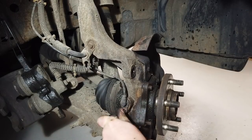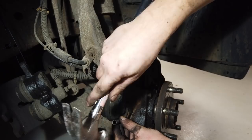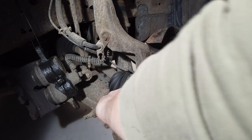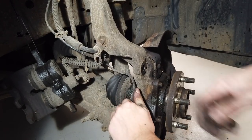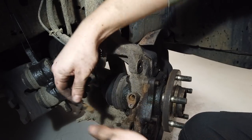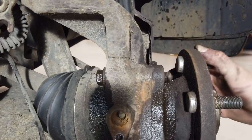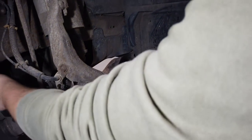We've got to inspect it - push in on that one. He ain't been out for a while - is he rounding? Tapping tends to loosen them as well. Give it a wiggle or you'll never get it out of the socket while it's still in there. We'll do it in the vice and drive it out. Try and rotate the ABS sensor gently before you try and pull it, then give it a wiggle. Give the end a wipe down - it doesn't look like it's been eroded, not too bad. You can see the ring in there with its little teeth. Spin the wheel and you can see the little teeth inside - that's basically telling the car whether the wheel is moving or stopped.